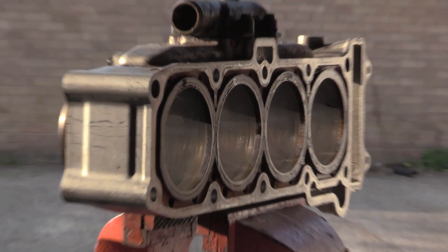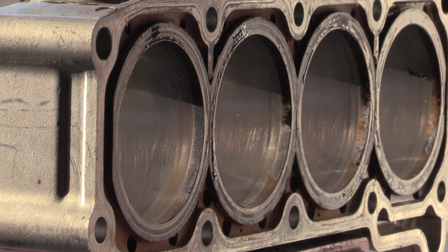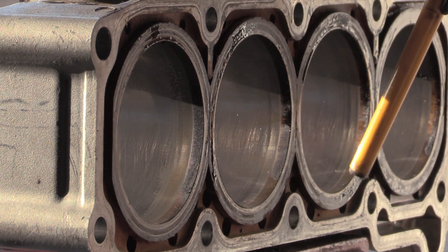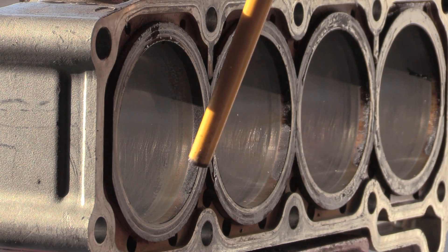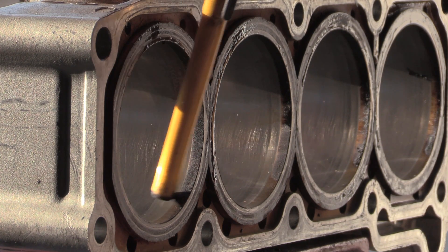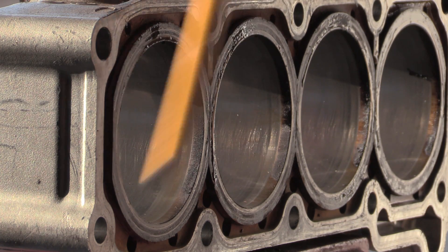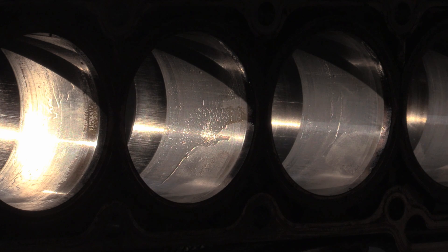From here you can see the ring bands at the top. I can get in there and point — so the ring bands at the top here, you can see basically where the rings just don't go. You can see some carbon deposits where it's coming down from the head — it's like moss, it kind of just grows. You can see there's this band here, that's the ring stop band. This is where the rings slow down, that's the most important thing.